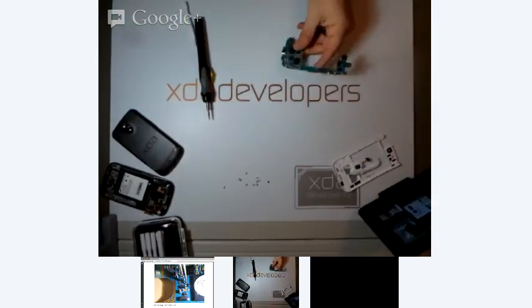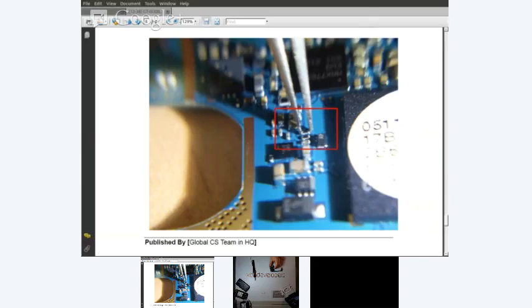And it would appear that it is the furthest one over to this side, as I was showing it on camera. Yeah. All right, so fire up the soldering iron, and we'll just bridge that resistor right over. And we can put in this SD card over here.